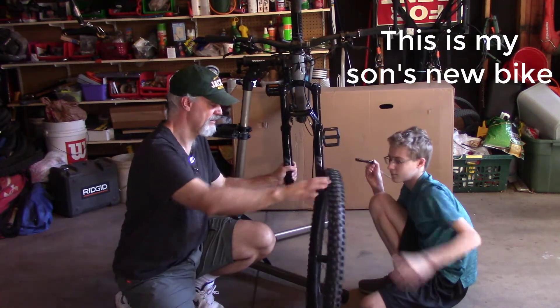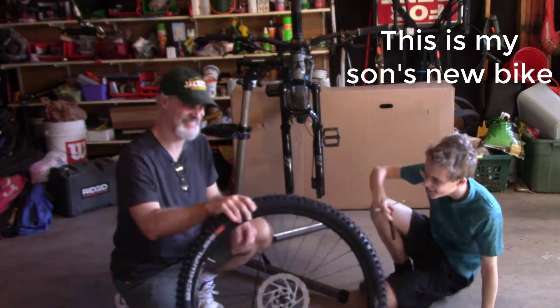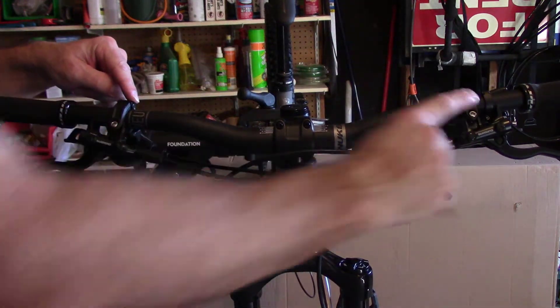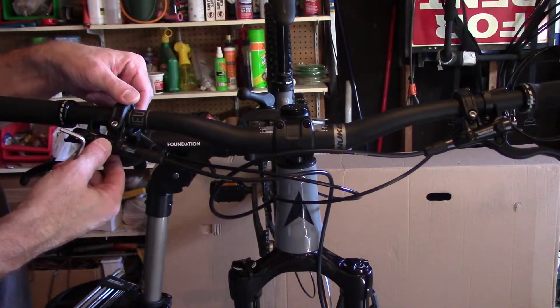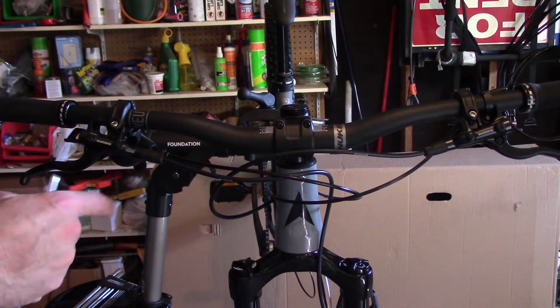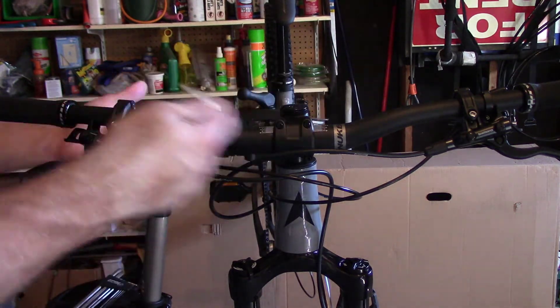Don't touch that disc. So the first thing we're going to do is take these mechanisms, these brake levers, and raise them so they're flattened out. The reason we're doing that is for any air bubbles — we're hoping to minimize that when we make the swap.